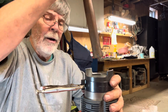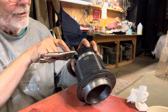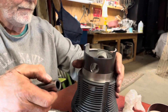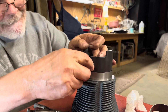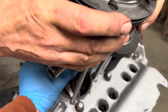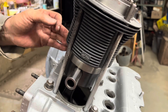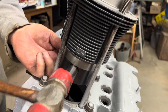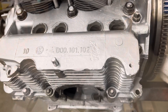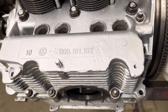Using the end of a hammer, I lightly tap this in until the rings are into the cylinder. I can look in the side and confirm yes, they are into the cylinder. At that point we remove the compressor — remember there's already a clip in this side. Put the wrist pin in, turn the engine until the piston comes to the top, then drop the whole assembly on. Install the other clip and push the cylinder down. We'll conclude the video here for now, but we look forward to getting those replacement rings and showing you the next steps. Thank you for watching.